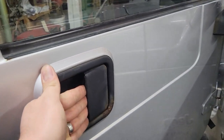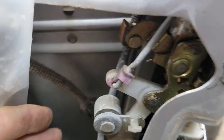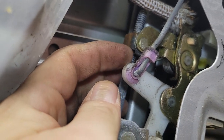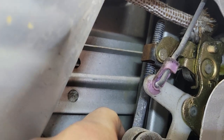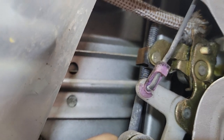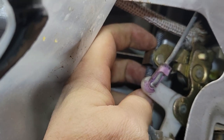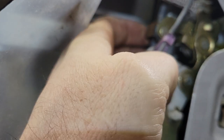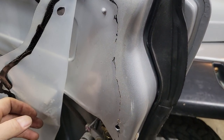When I put it back together I was able to adjust that a little bit. If yours is kind of where it doesn't release right away and then you really pull on it and it finally goes — what you can do to adjust that is right here: this is just a spring clip, and if you get in behind here with a screwdriver, this rod just pops out and you can adjust it up and down. Pulling this down all the way is what releases the door latch. So if you're seeing some wear and you're having a hard time getting the door to unlatch, you can pop this out, maybe pull this rod down one or two threads and snap it back together. That gives you some adjustment to make sure you don't have a hard time getting in and out.